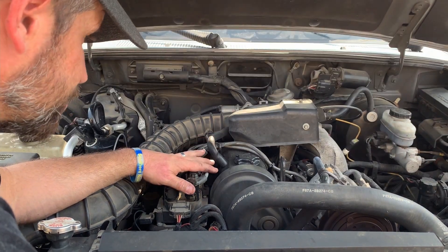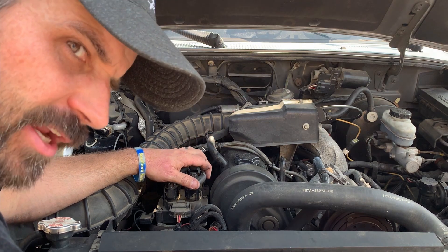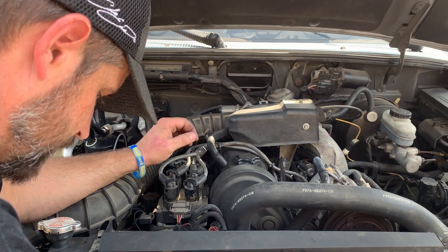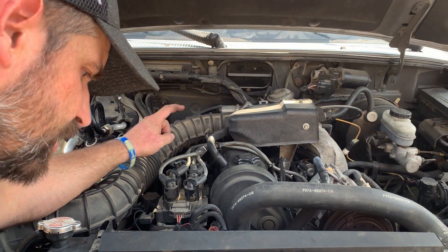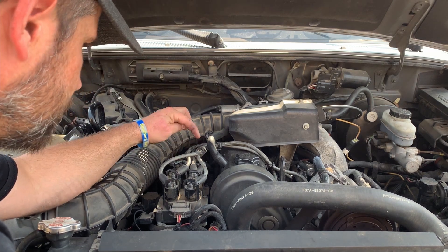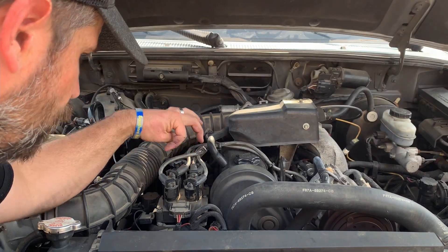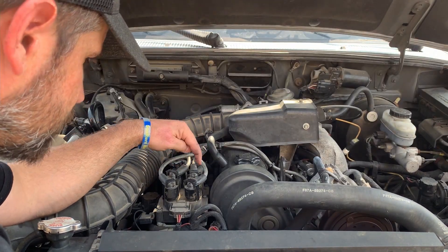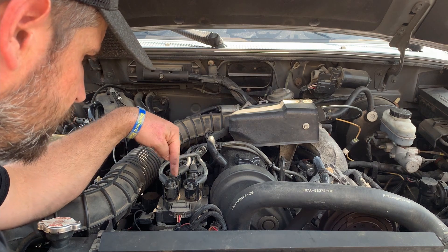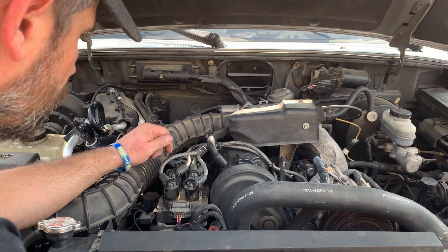This is the one that's got a little bit longer stroke, a little bit longer rod — the one that the racers like to get the crankshaft and cheat with at the dirt tracks. Starting at the back, the firing order is 1, 3, 4, 2. The front coil pack is the same but flipped around, so it's 2, 4, 3, 1. I've double-checked those and made sure they're going to the right plug.